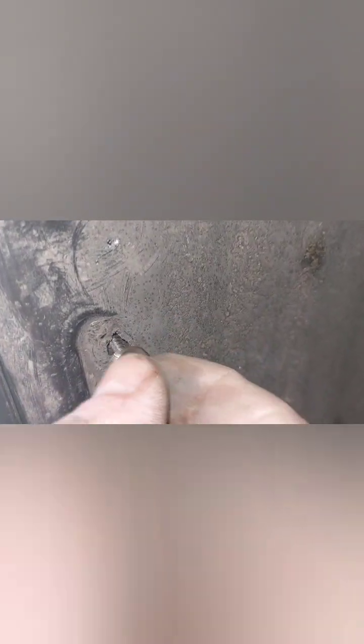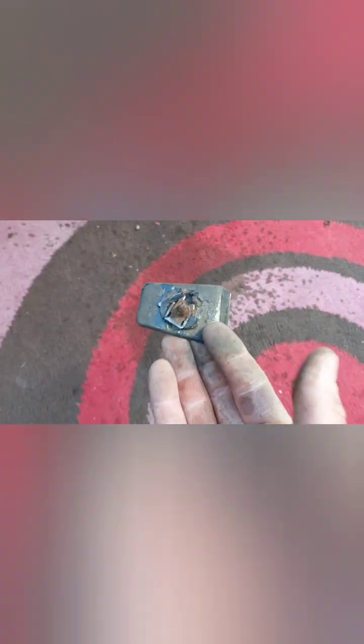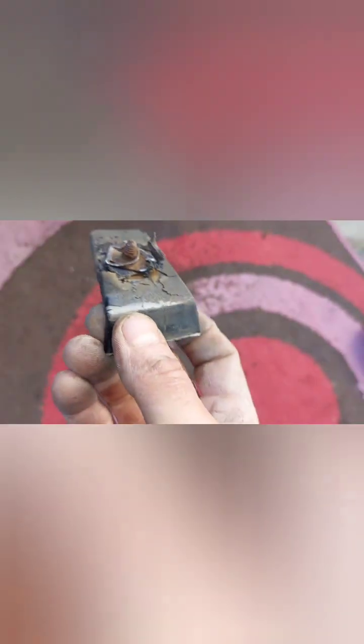There it is. So I'll put a little stainless steel screw and a little washer. Just hold it on there. It's really good to put stainless steel fixings wherever you're gonna be, or anyone else be removing that. I did use just normal galvanized ones to repair the brackets underneath, because once that goes on, really no one should ever need to remove that, but the ones that are removable, it's best to use stainless steel, avoids getting everything rusted away like this. If the manufacturer, instead of using just normal steel, used a bit of stainless there, we wouldn't have that problem.